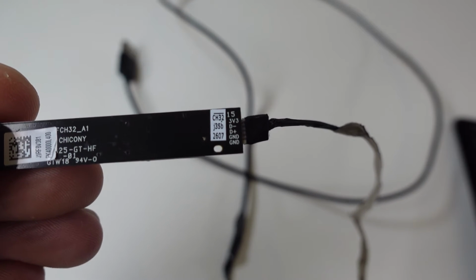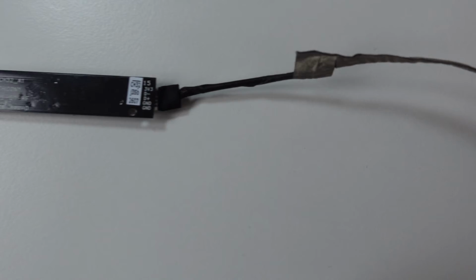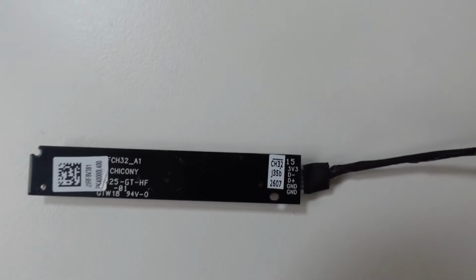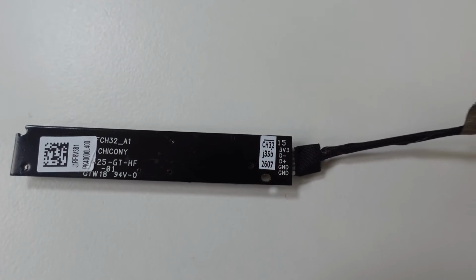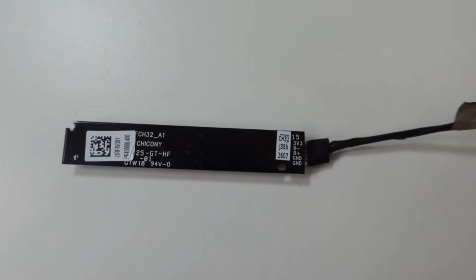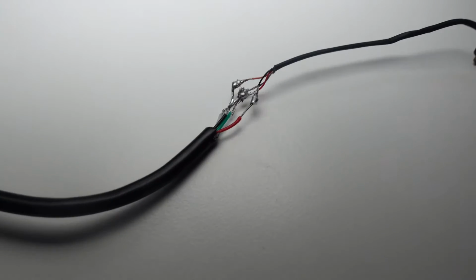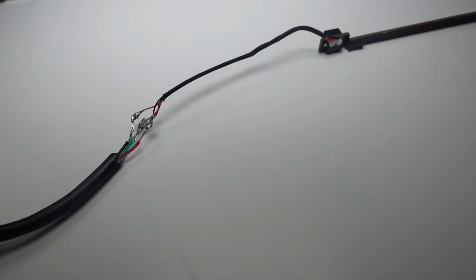All I had to do was look on the reverse of the webcam, and it told me what each wire did. So you can see at the top there that was a positive, so 3 volts, minus and plus, minus D, which is minus data, positive data, and then ground. So there was this very easy description on the back, which I followed and wired it up to the corresponding wires in the USB cable, an old USB cable that I'd found that was already damaged on one end.